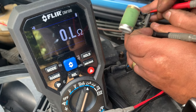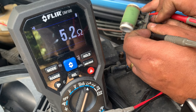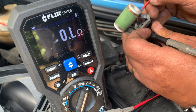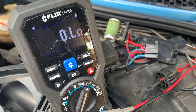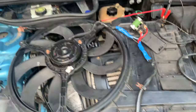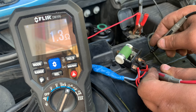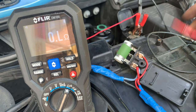I'm pretty much bypassing the thermal fuse - and there you go. If I go on the fuse itself - open circuit. So that's what happened: the fan was seized, basically it wasn't moving, the resistor was getting hot, and the thermal fuse blown. If we go to the new second-hand resistor - you can see one ohm. So that's good. We're going to try to explain how the system works now.